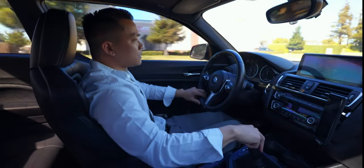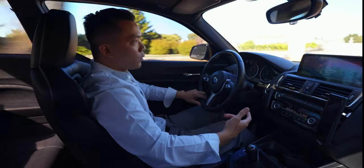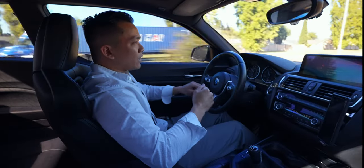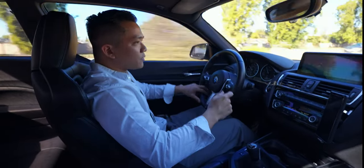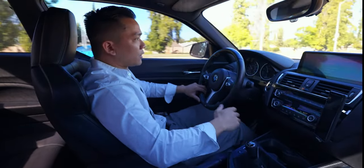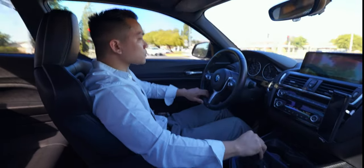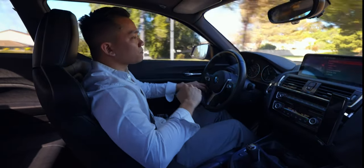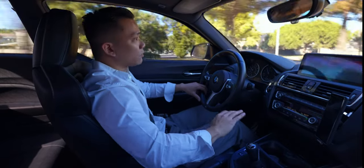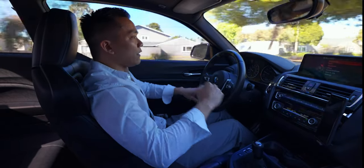That same issue also happens under higher acceleration shifting. If I'm getting on the freeway and need to match someone's speed quickly because I'm in a lane that's about to end, I'll get a grinding effect — the same thing as that first gear scenario. It doesn't want to grab on; it seems like the clutch didn't open up to receive the new gear. Either I have to press the clutch back in, let out the shifter and re-engage, or it just spits out the shifter entirely and I have to clutch in and re-engage.